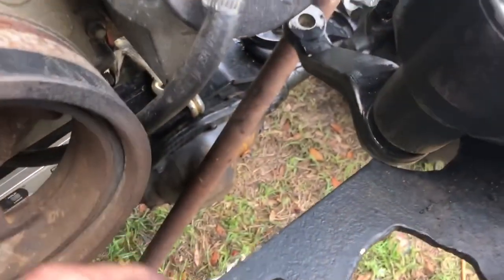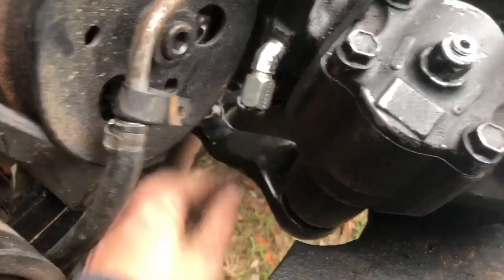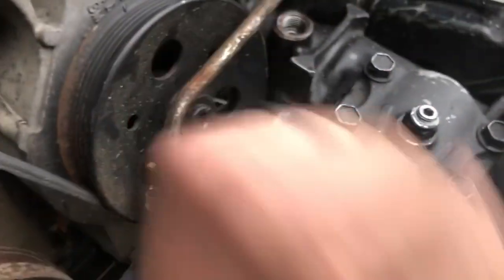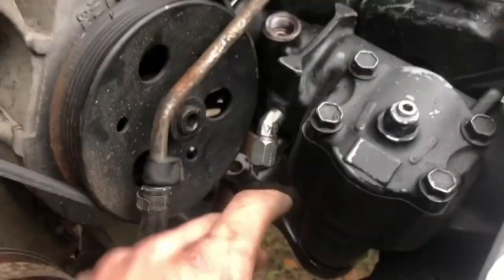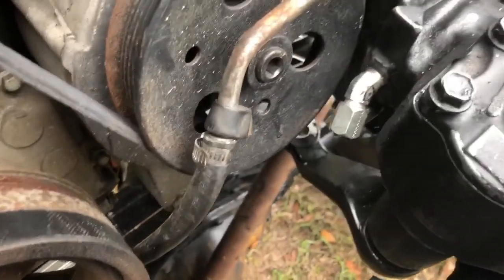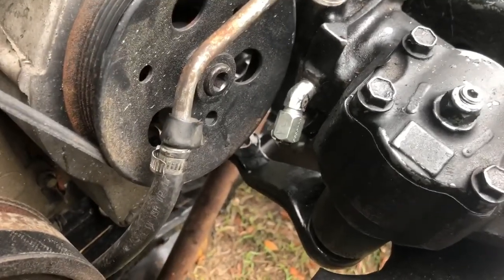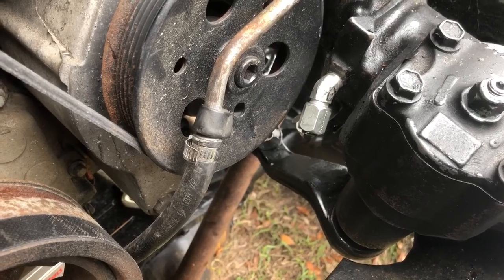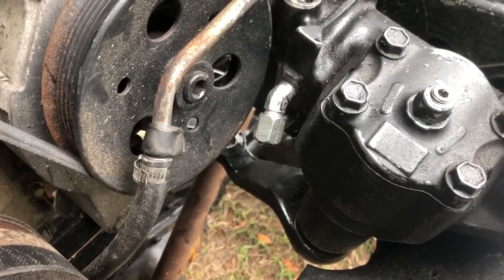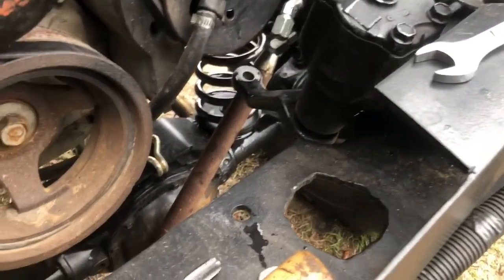What I plan to do is whenever I get these lines hooked back up, I'm going to run a hydraulic line straight to a bucket — both of them — and then cycle the steering back and forth to try and flush out any metal that may be inside this box, so I don't start pumping it through a cylinder or through my whole system. Appreciate you watching. Hope I explained it in a way you can understand and showed that you can do it yourself, save some money, and not pay a shop to do it. Give this video a thumbs up, subscribe — all that fun stuff.